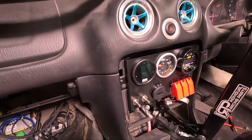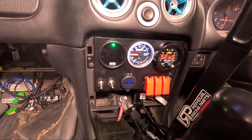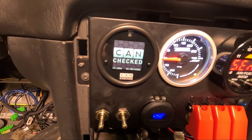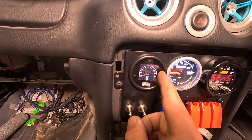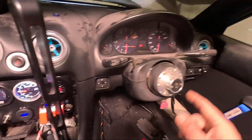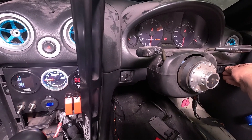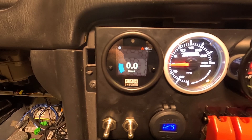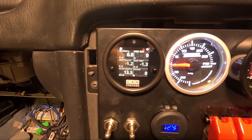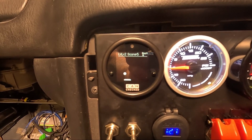It's time to turn it on and see whether we've got power and whether the knob works — I don't expect it to do much as the ECU is currently unplugged for safety. Well, it's working! Up at the top a symbol flashed to say there was no connection, which is correct since it's not plugged into the ECU. Let's check whether the control knob is talking to the CAN Checked gauge. That's working well. And — am I really playing Pong on this? I didn't even know that was a feature!